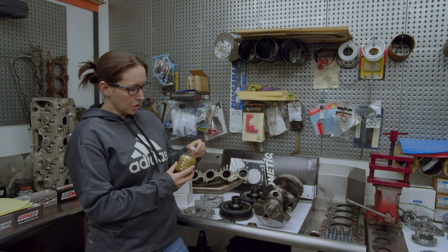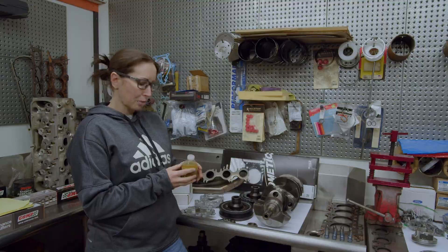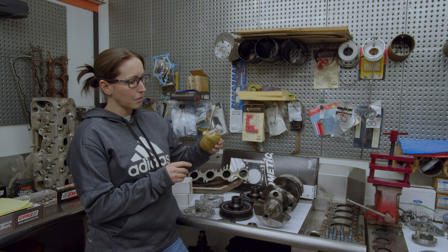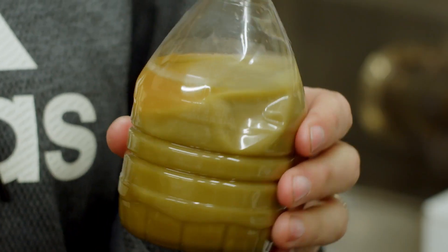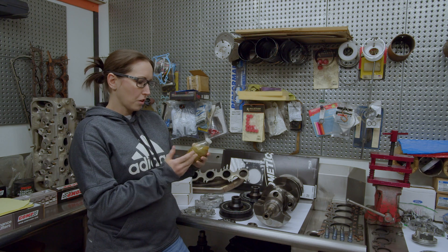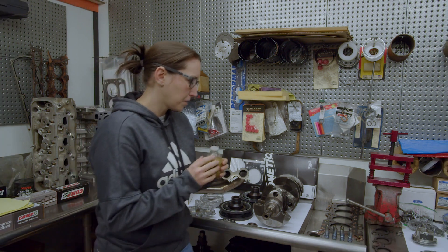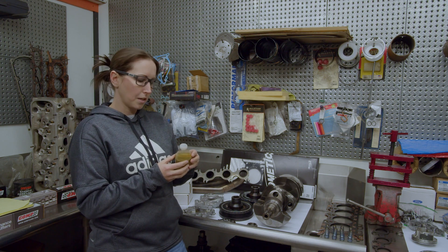The first thing you typically do when you take your car down is get the fluids out and take a look at the oil. In our last race we had some issues. I saved the oil in a clear bottle — this is pretty bad oil with only about eight passes on it. There's a ton of fuel inside the oil as well as all kinds of other stuff. That was a big red flag; we were not having this problem early in the season.